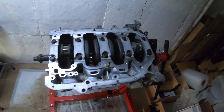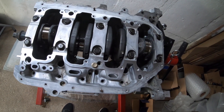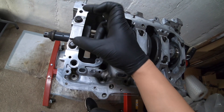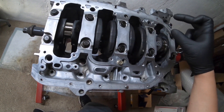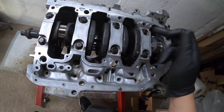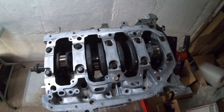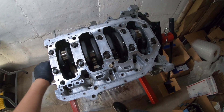After looking over the footage, I realized that I didn't get to show you how to drop the crank into the block. To quickly go over this: you would have to put assembly lube in each of the bearings — assembly lube on the block side and the girdle side, back and forth. You put assembly lube there, and you want to install a new crank rear main seal. After installation, you can see how smoothly and effortlessly this crank just spins in there.